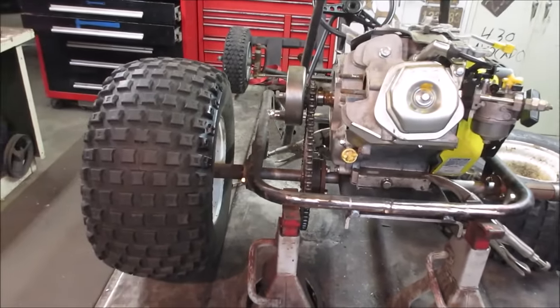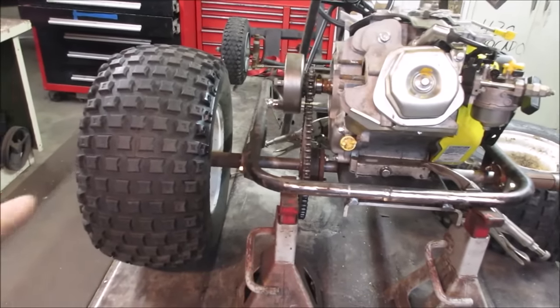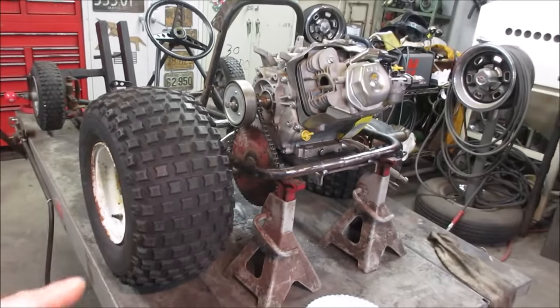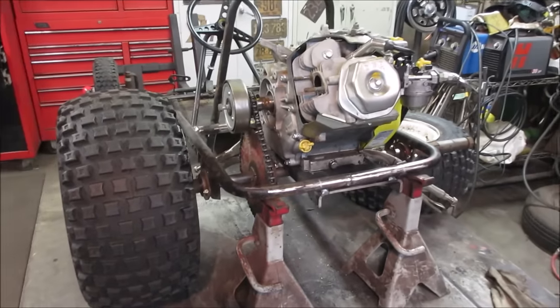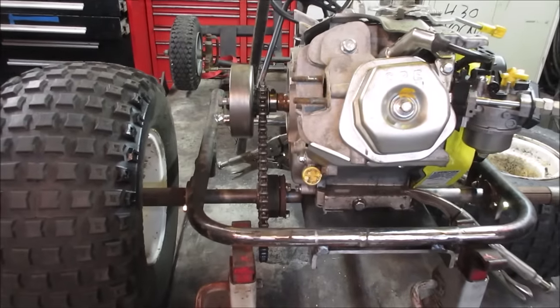Tires were going flat. We injected oil in them and they seemed to have stopped leaking. So that kind of worked out well. They were really cracked and air was coming out of everywhere, so we got those fixed up. They do not leak. They are still holding air. It's about 5 days later. At the end of it, we fired up the engine, spun everything up, to see that it worked decently. The sprocket ended up walking and kicking the chain off and throwing parts everywhere.